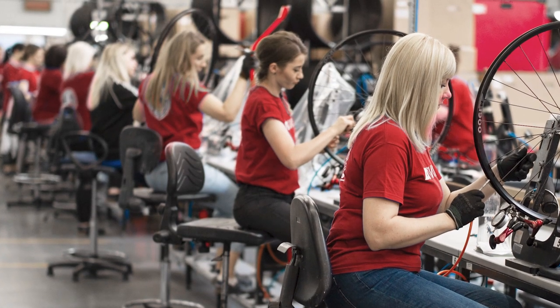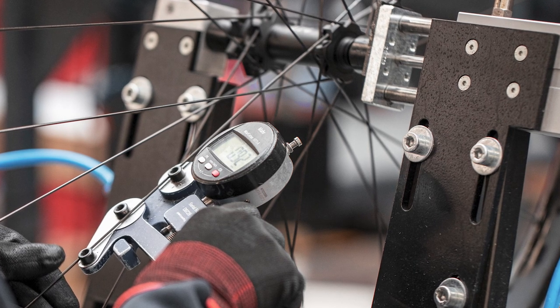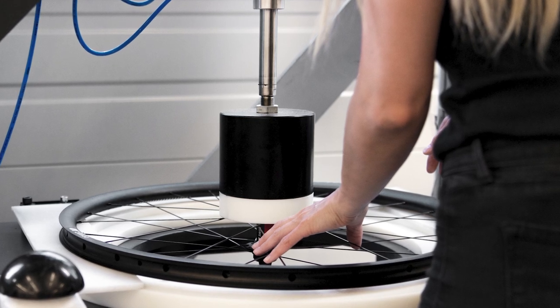But reliability is not just a question of the freewheel system being used. Besides using a ratchet system, the wheel build makes an important difference. All DT Swiss wheels are built by hand in our own facilities by experienced wheel builders, and this offers an outstanding standard. For example, looking at the spoke tension of our wheels, the more consistent the spoke tension is, the more reliable the wheel. We achieve that by de-stressing a wheel several times per side during our wheel building process.